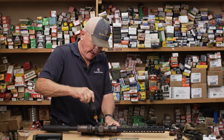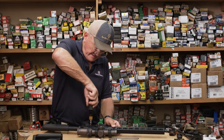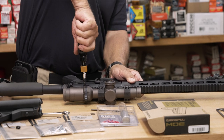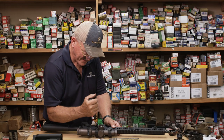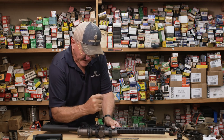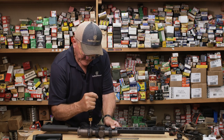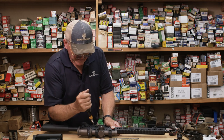I've got the lug engaged forward, and I'm going to go through them just like you would tightening anything in sequence. I'm going to start in the back here, bring it to a click, move it up to the front, click it once here. This allows you to tighten it right to spec and not damage the equipment by over-torquing it. Then I'll come back and test each one again.